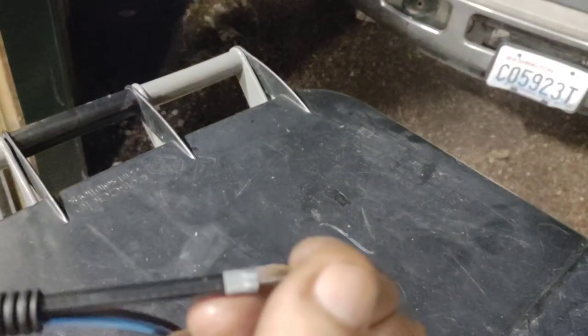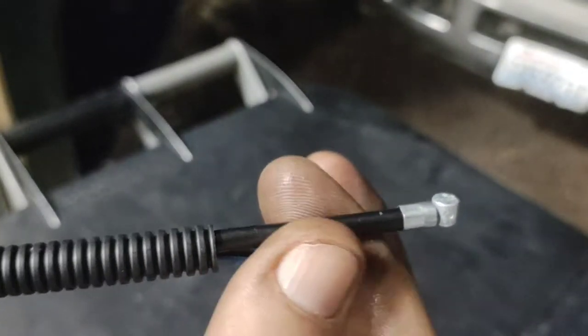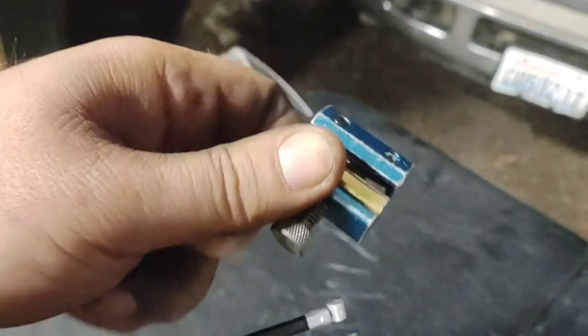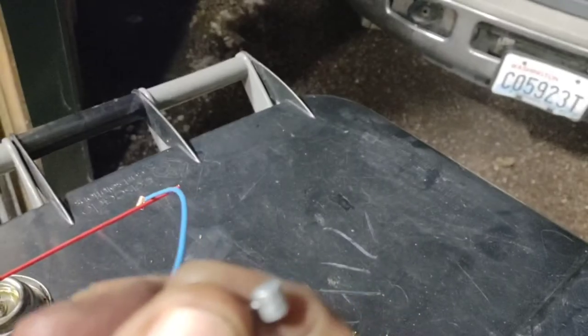Today, if you have one of these types of cables — it's got multi-strands like this one, it's flexible and it has a sheath — this one is for a BR 700 or 600 blower. You should be using one of these, which is a cable luber, and you should be using this stuff which is called Cable Life cable lube. It works wonders before you change the unit on it.